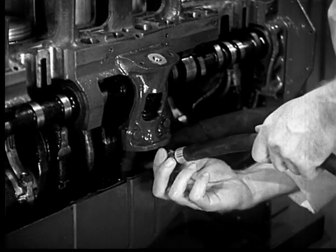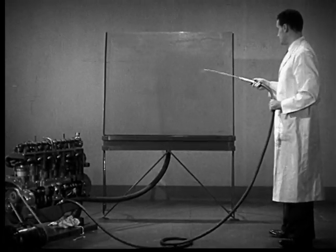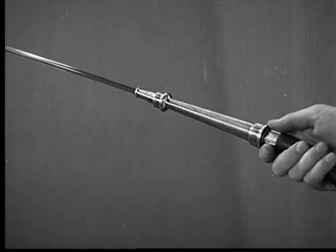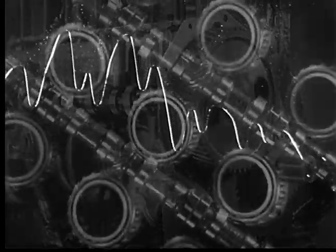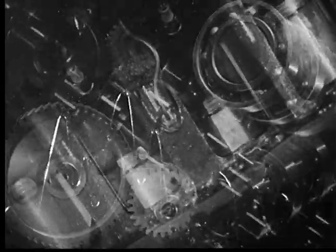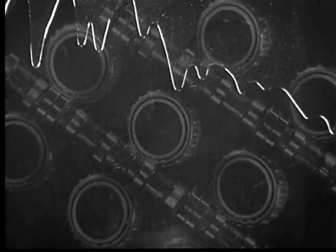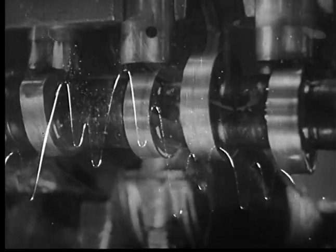By connecting a hose to the pump and arranging a return pipe, we can see the amount of oil that flows from the pump each minute that the engine is in operation, enough to fill a bathtub in 3 minutes. Closely fitting, highly polished parts, moving at high speeds, year in and year out, demand an adequate supply of good, clean oil to protect them from friction and wear, to give power, economy, smooth, silent operation, and long life, with every part riding a film of oil.